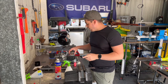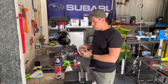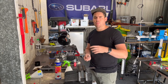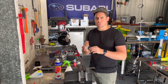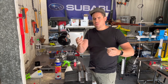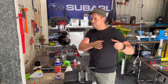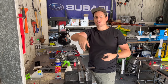After yesterday I fixed up the bolt situation — just got a couple more. I've put red thread locker in there, and while I'm waiting for that to dry I'm going to make up a bracket for the turbo mount. It's just going to sit on the exhaust flange to give it a bit more support, so all that pressure is not being pushed down on the manifold which only has two connection points underneath. It's a bit of a wonky design anyway seeing as it's a horizontally opposed engine — it's not just one log, it's this whole long thing like you've seen before.